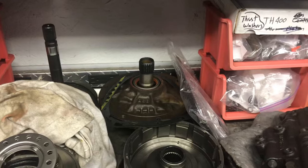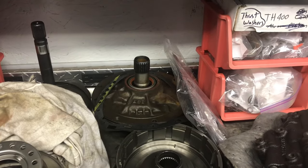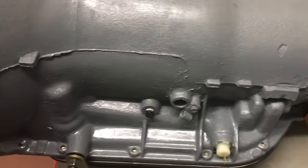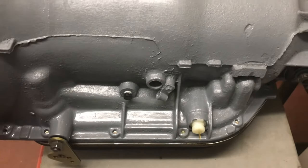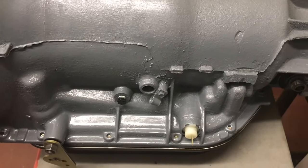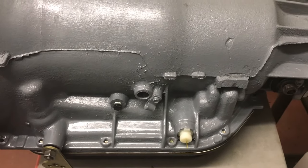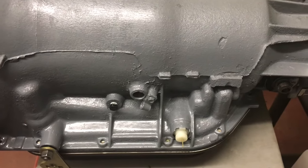With the increased pressure from the spring installed in the pump, I go ahead and do the engine thrust protection mod — it's in my other videos and all over the internet. It's not going to make the transmission last longer, but it'll push on the engine's thrust bearing less with a simple mod to the backside of the pump. This transmission has a billet internal solenoid transbrake valve body — it's a very popular one sold by a lot of people, and also the last one I'm going to install. Since joining the DIY Turbo 400 site on Facebook, I can now see there's an American-made choice — Jake's Performance, ATD Automatic Transmission Design, and others in the same price range. I've installed probably ten of them with zero issues once I figured out the poor instruction sheet.